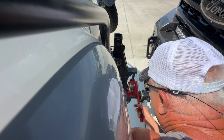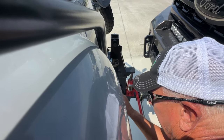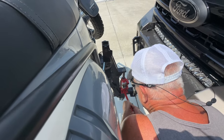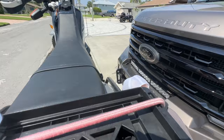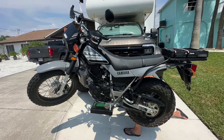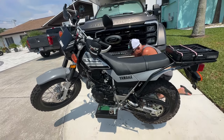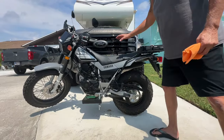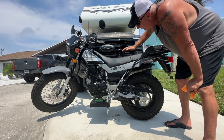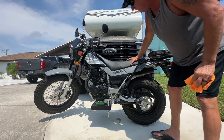So I got the pin unscrewed. You have to take a little bit of pressure off — lift this up a little bit — so it takes the pressure off the pin and the pin comes straight out. When you're traveling, that prevents it from falling. Then go to the release valve and lower it down slowly so you can see how it's done. There it is — all the way down. The bike is on the ground. We have an elevation off-grid truck with campsite leveling, and I have the suspension lowered about four inches, which lowers the bottom of the truck a bit to help us do this.